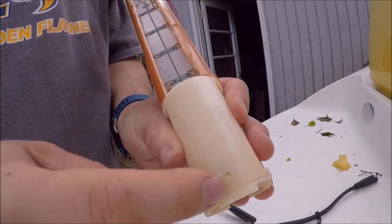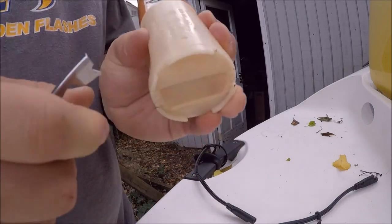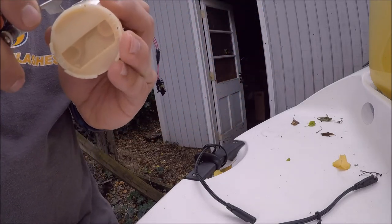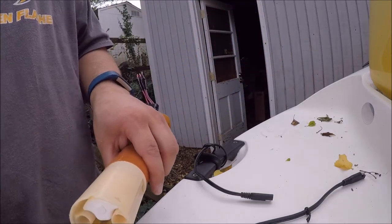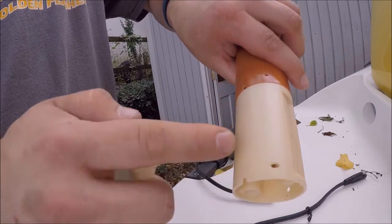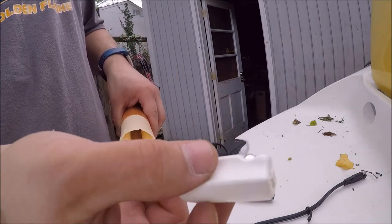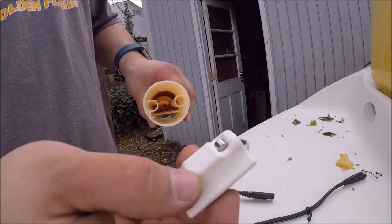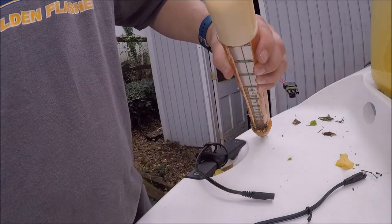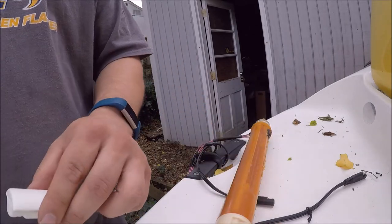What you're going to do — the first step — take out the bottom of it right here. This is like a fuel screen. It's got a fuel screen there to filter out all the crap. Push in these tabs that are inside there — there are three of them — and it's going to enable you to pull this out. This is your fuel screen. This is your fuel float. It goes inside here and rides on that rail up and down based on how much fuel is in your tank.